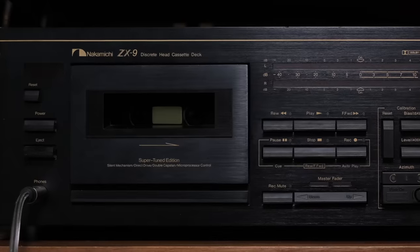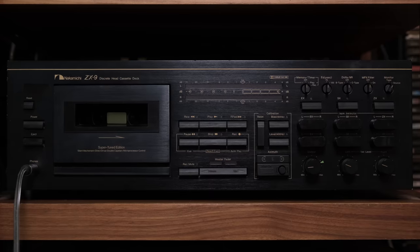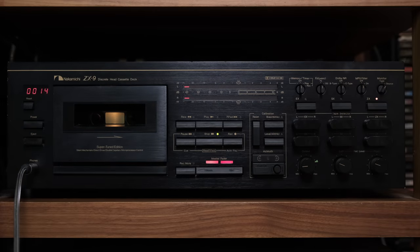For our last point we'll look at the physical characteristics of the deck, understand the calibration features — why they're so important and effective — and then do a manual calibration and a test recording to listen to the sonics of a high-quality recording. Okay, here we are with the fantastic Nakamichi ZX9. Let's turn it on and take a look at the main features. You already see a cable inserted because it's directly connected to the video camera — it's going straight to the camera preamp.